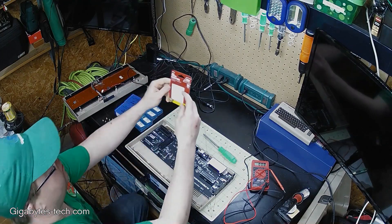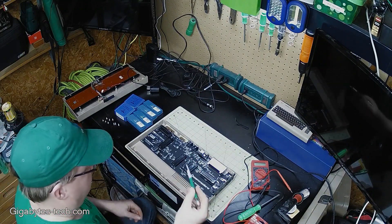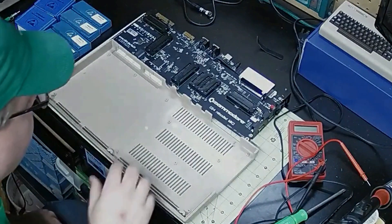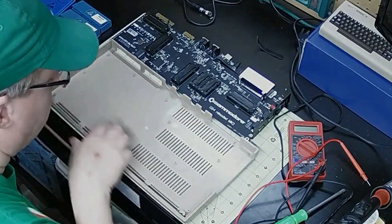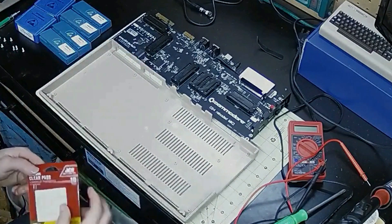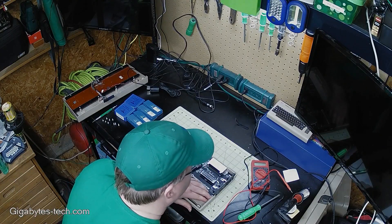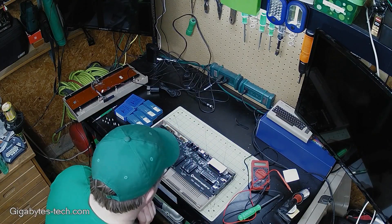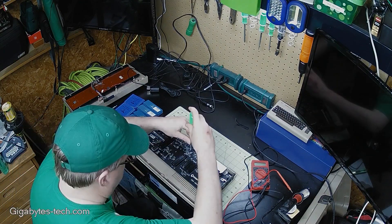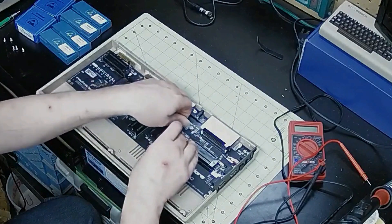These are very small feet for devices. So what I'm going to do is mark the location of the holes — I've got three little marks there. At each of those mounting locations, I'm going to put one of these little feet right there. That's where we want the height to be. Let's go ahead and get these screwed down. I'll start with the middle. These are zero insertion force sockets, otherwise known as ZIF sockets. When the levers are flipped up, they're ready to receive those chips.